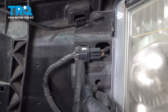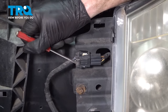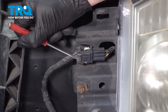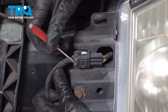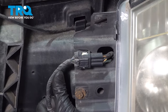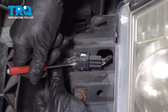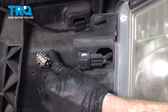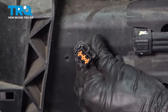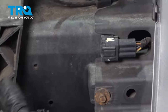Let's continue on to the wiring harness for the headlamp assembly. To remove this, come right inside this area and press on the locking tab. You can do this by hand or with a small pocket screwdriver. Once you do, separate the wiring harness. After you have it disconnected, take a peek at the wiring harness — if you see any funny colors, that's corrosion and it would have to be dealt with.